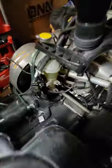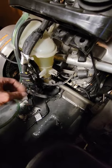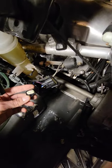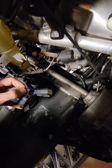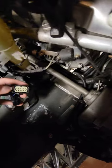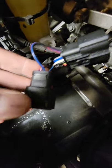After the fuel tank slides back, your main harness will sit down here, zip tied to your coolant tank. Cut that zip tie and unplug your main harness — one end goes up to the handlebars and the other goes down lower. The aftermarket part we're installing has two pins that you have to push out the back of this connector, then replug in two new pins into the harness. The two old pins go side by side, colors matching, into the new connector.